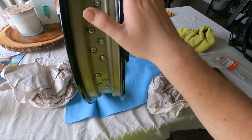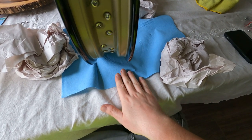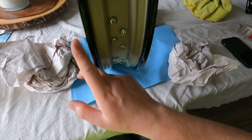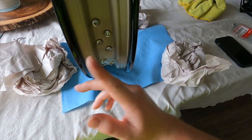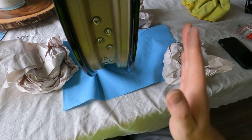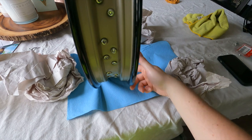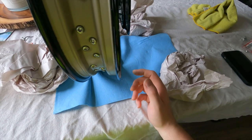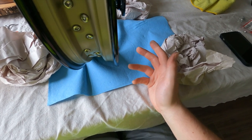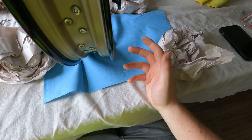Basically if you put it on a stand, spin it, and have a piece of wood at the bottom — if it touches on this side, you come to this side on top and tighten it a little bit, and that's going to suck it in. If you're checking for wobbles going side to side, if it's hitting at the top, you go to the bottom on the opposite side. I'm actually going to have a shop do this because I don't have the micrometers or the stand, and it's just easier.